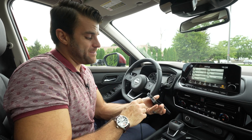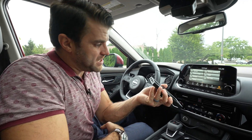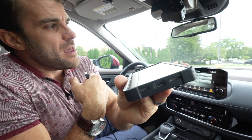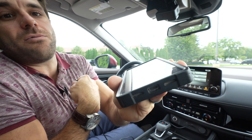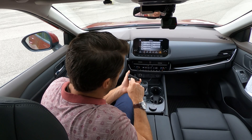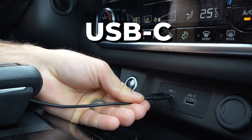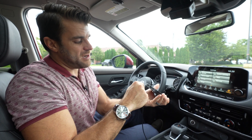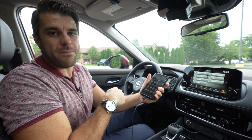Another common issue is making sure you have a stable USB connection. My phone is actually a perfect example — if you look at my USB slot, it's all grimy in there. These USB connections are very sensitive. Your USB could be broken; sometimes it will charge your phone but won't allow for the file transfer connection. Make sure you clean it out — both USB-C and regular USB cords will work. You want to hear that click when you plug your phone in.